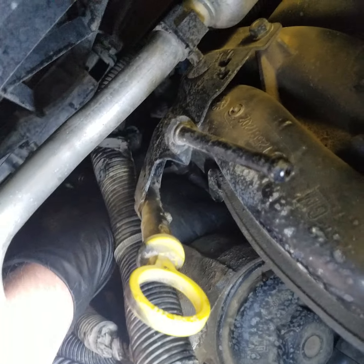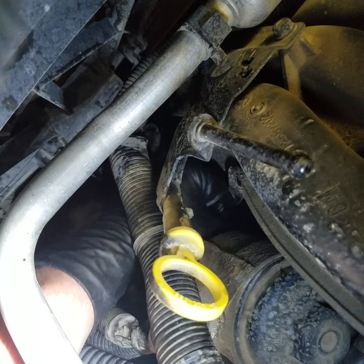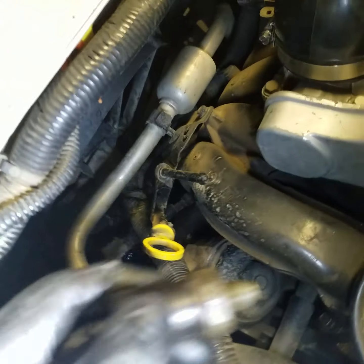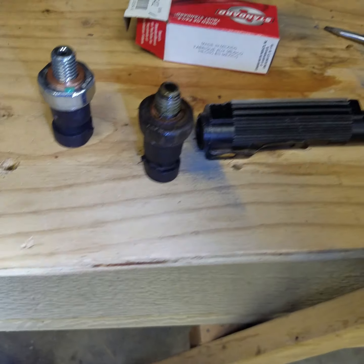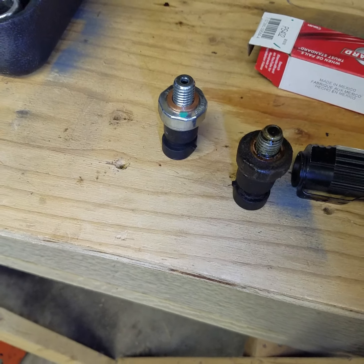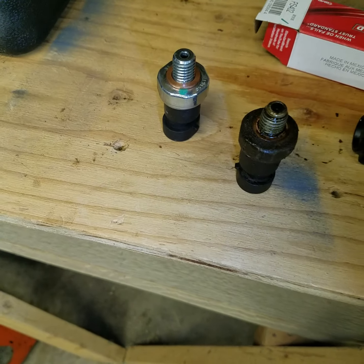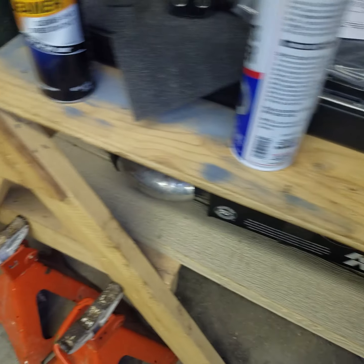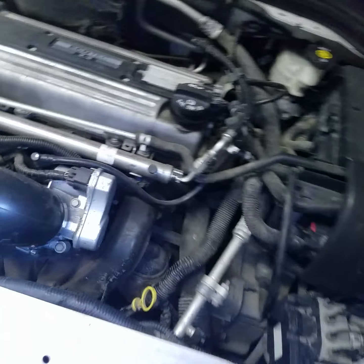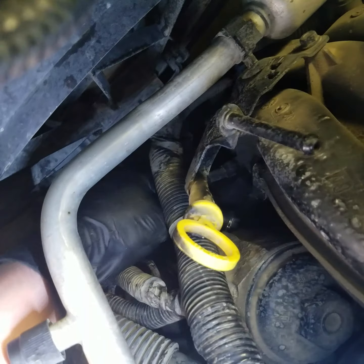You can screw it out with your hand, just like that. Should look about like that — mine's been leaking really bad, that's why I'm replacing it. Here's the old one, here's the new one. When you pull it out, if the vehicle hasn't been run, more than likely a little bit will dribble out. I was just running mine, so it was fairly hot and it was coming out right away.